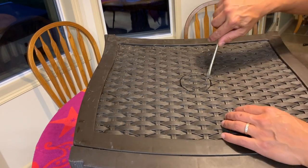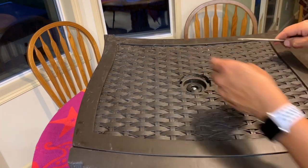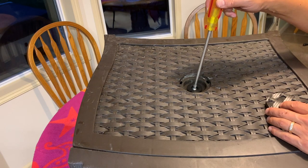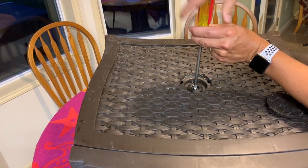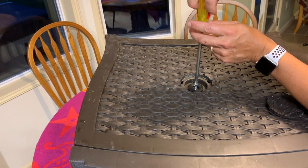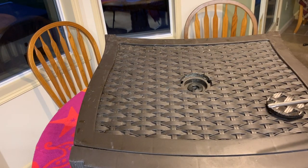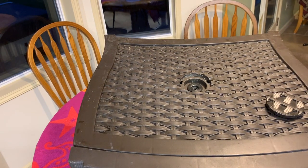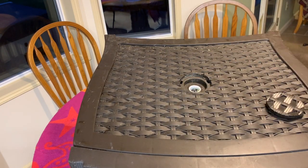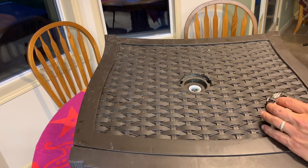On the back side there's a little cover here — just snap that off. Inside is something that holds the hub in place. Just take a Phillips screwdriver and remove that. This little hub retainer should allow us to remove the motor once we flip this thing over.